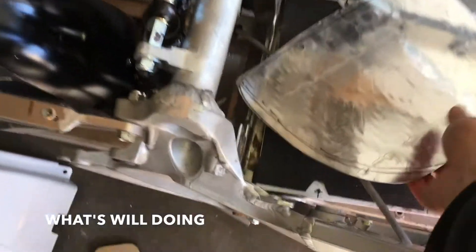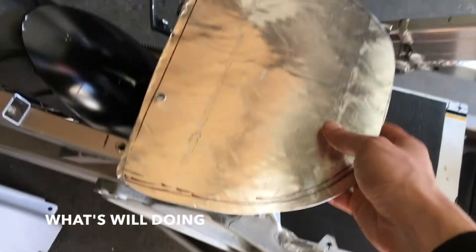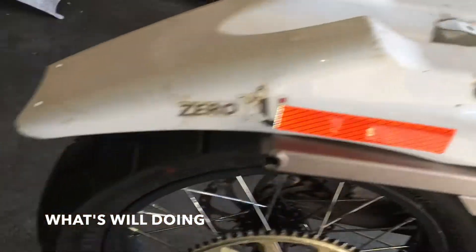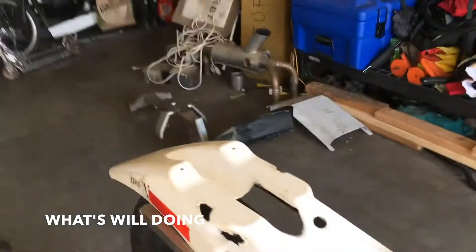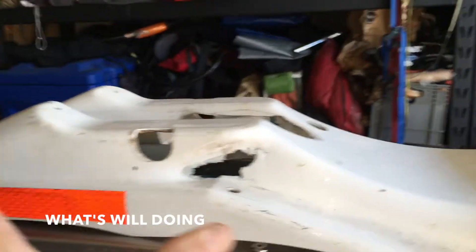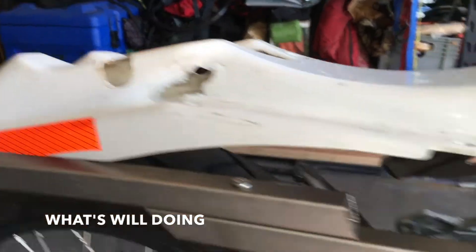Let me show you how I'm going to do the seat setup here. I made these aluminum plates — this is basically going to be my seat pan. To make it more comfortable, we'll have some foam, with the fender more or less on top. Then to support it, I'm going to have some angles here going from this hole to the back of the subframe. That's the subframe — I'll have to build out on top of the rear part of the subframe to hold this and where the seat's going to go.